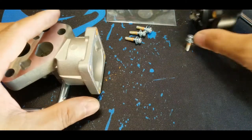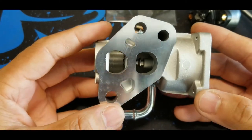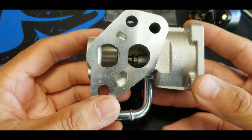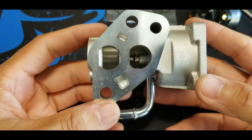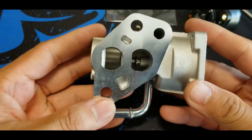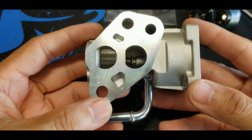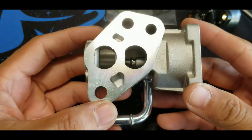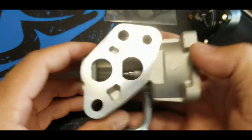Anyway, this video is just to show you guys how to replace the EGR valve. I'm not a mechanic, I just do DIY for my cars and everything if I could. And so when I started having that issue, the rough idle and stalling on the red light, I used my code reader to get the error code, and I got the 0401. And according to Mazda 5, you have to clean the throttle body, as I mentioned that it didn't help. And I searched on YouTube what's the possible cause, and then yeah, I found this YouTuber. Actually, I remember his name is the Photo Mike Garage. Shout out to him. And yeah, he replaced the EGR valve, and he said that it fixed the issue. So again, the EGR valve is not that expensive, so I bought a new one, and then I thought to give it a try.